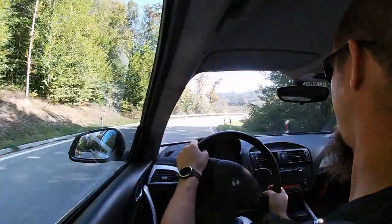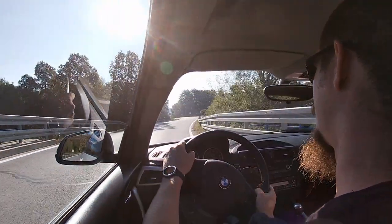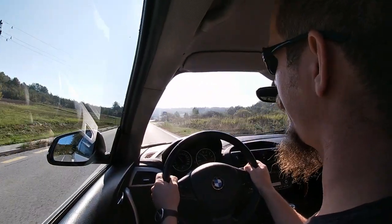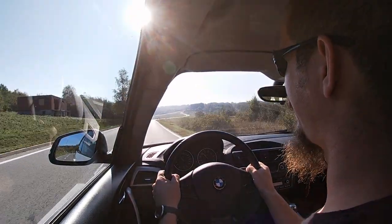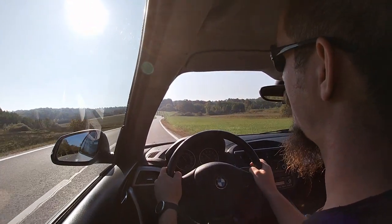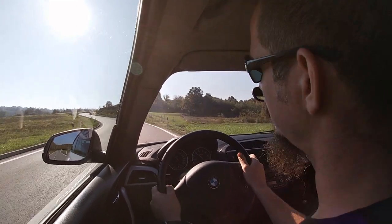Wheels and tires — I won't even mention that. You know that if you buy a car you need to get better wheels and better tires, so that's a no-brainer. As for the rear sway bar, anti-roll bar — it depends on what you want. With it you get a tiny bit less traction at this power level, but it does give you a little more driftability. It was cheap, so why not?